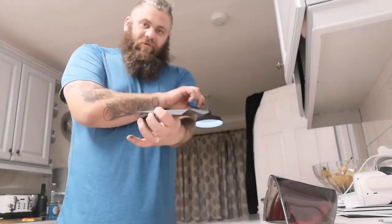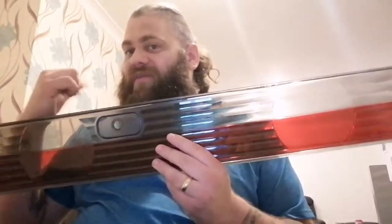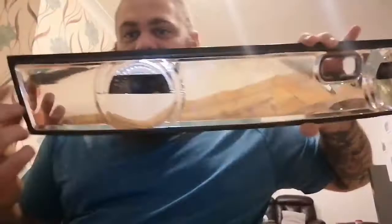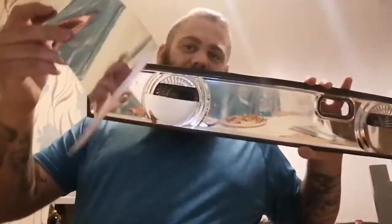I'll use this template to flip it upside down for the other side, transfer it to a piece of clear perspex or polycarb, trim it out, and hopefully once I give it a bit of heat I should be able to mould it in shape, chuck a bit of cold water on it, set it and then glue the polycarb straight to the clear. I couldn't help myself doing a bit more - the middle panel has come off all intact. It was easy with a heat gun. It's a real shame because if this was the clear and red I would have been able to use isopropanol on this red - it takes it straight off. But this is actually tinted plastic which is a real shame.